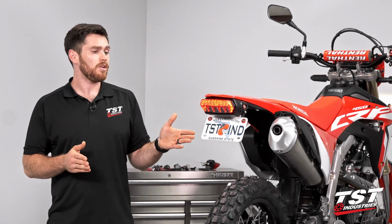Now, if you did notice, we didn't run into a hyperflash during this video. That is because we went ahead and installed our TST Industries flasher relay. Typically, if you pulled off those OEM signals, you would have experienced that hyperflash. We went ahead and threw that in there so that we didn't have to deal with that during this video.